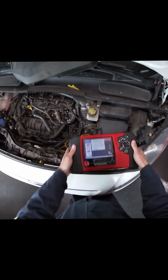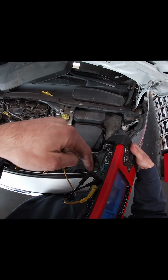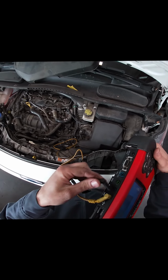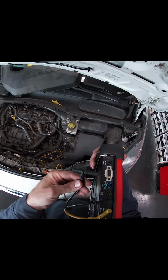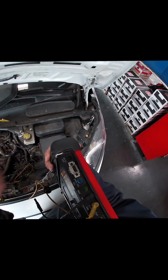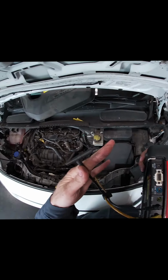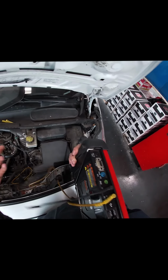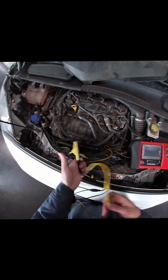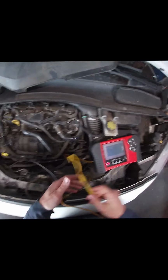If you catch this on something, you're putting pressure on the port. You don't want to do that. So I take the elbow, put that there, and then this is for a ground. Now you're grounded for this channel if you needed it. But let's say you want to use an amp clamp, put it here. Here's your ground. Splice in right here. Volts. Ground. Alternator. Volts.